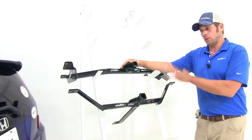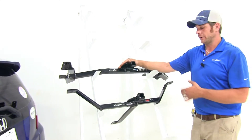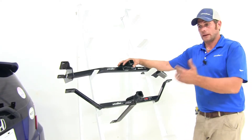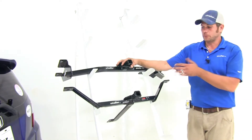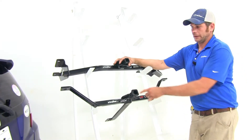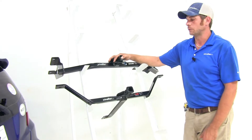Small trailers are going to be one use for these, along with smaller bike racks and smaller cargo carriers. Class 1 hitches are rated for use with up to two bikes — you don't want to add too many bikes, as you'd start putting unnecessary stress on the hitch. For cargo carriers, you just want to stay within the capacity of that 200 pounds. You'll need inch-and-a-quarter by inch-and-a-quarter accessories, and you want to be sure those are rated Class 1.